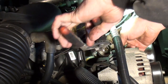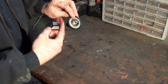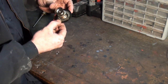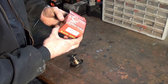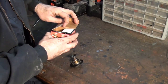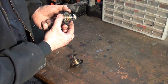She's out. Let's go over to the bench and look at it. As you can see, this thermostat is cold and it's stuck open. What that's doing is allowing the coolant to circulate through the entire system, including the radiator, before it's at operating temperature. This is supposed to be a 195-degree thermostat. The replacement I got is a failsafe, rated at 195 for this application. The failsafe simply means that if it fails, it will stick in the open position like this one did, and allow the coolant to circulate without overheating the engine.